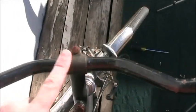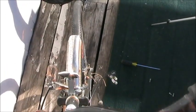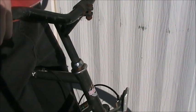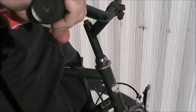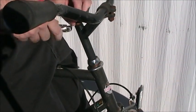Now that we have pretty much everything apart and the handlebars are off, we need to loosen this and turn them forward again. Let's go ahead and lock it back into place. You take your wheel, center it as best you can with your feet, like so, and then you take your handlebars here, which are free turning. We go ahead and wiggle this into the tube a little bit, pulling this wheel in, wiggling back and forth to the minimum insertion mark. Now make sure that's aligned with the front wheel — it'll be very annoying if it's not.